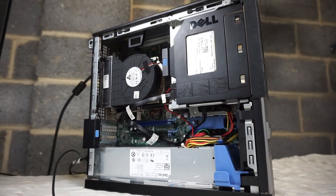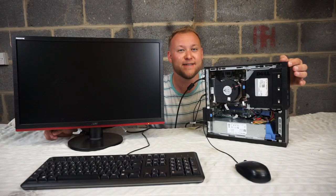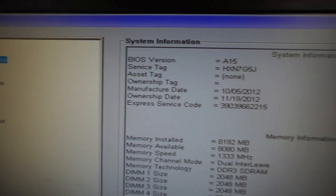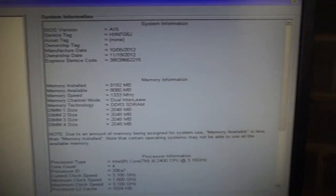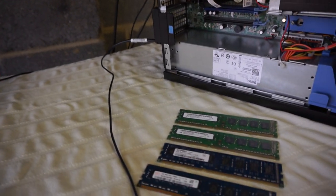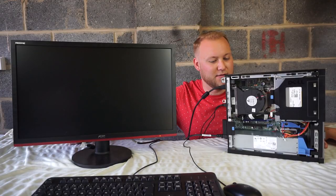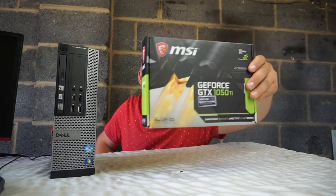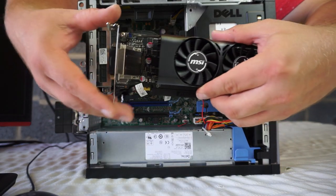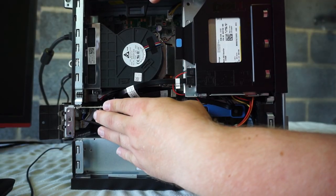Just how much better does that look now? Do you think it's going to turn on? Under system information we're showing 8GB of RAM — 2x4GB — but I think we can do slightly better than that. So I've gone ahead and found 16GB of RAM, 4x4GB, and I'm going to stick them in and see if that works. Yes, it boots! So the next thing is to install the graphics card. We've gone for the GeForce GTX 1050 Ti. This is actually a low profile graphics card and it doesn't require any external power, so it's ideal for these smaller units.